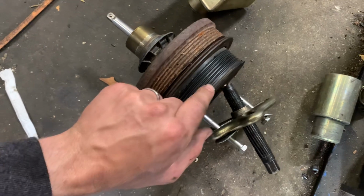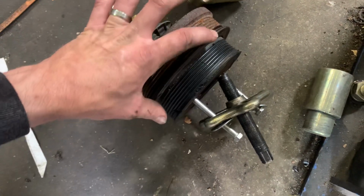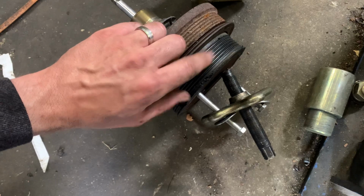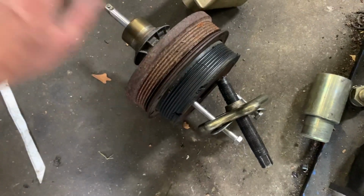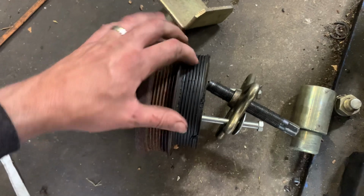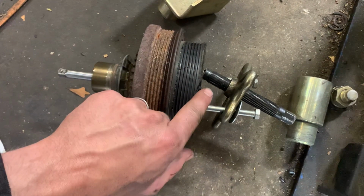And what happens is, as the rubber wears out, it actually breaks the seal between this and this. And this part of the pulley itself starts to walk backwards, and then it pushes the belt down onto the rubber. And as soon as the belt starts to jump, it forces this back really quick. The belt lands on this. Stuff is falling over there. It's still falling over there. There is a very slight lip right here, which keeps the belt from walking all the way off.